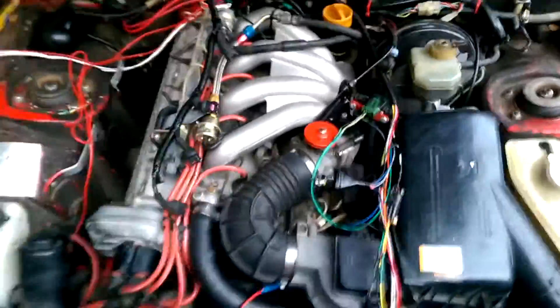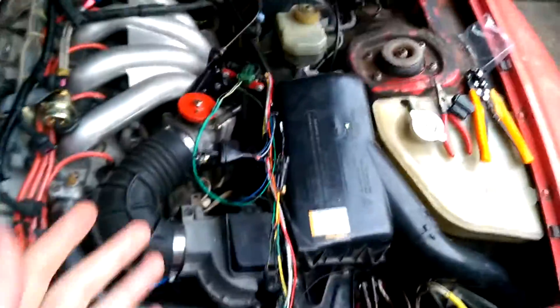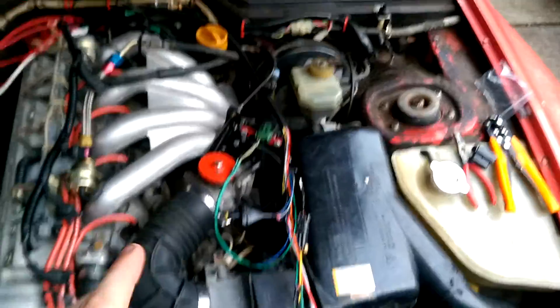Hopefully tomorrow — actually, I'm going out of town for a couple days. But next time I'll be firing the engine over using the DME and the stock harness and injectors, but running MegaSquirt in piggyback mode just to make sure that I'm getting a clean RPM signal. Because without an RPM signal, you're not doing anything.